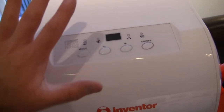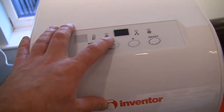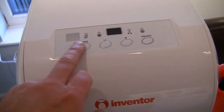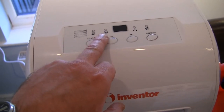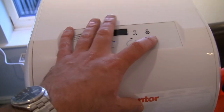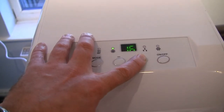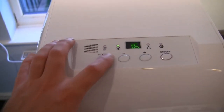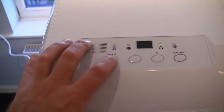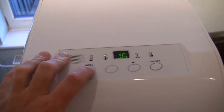After playing around with the settings on this unit, I can tell you I found the best mode. There's actually cool mode, dry mode, and fan mode. The best way to operate this is to turn the unit on and press the mode button until the first green button lights up — that's cool mode. Then press the minus key until you get down to 16. That's how you get this unit the coldest. The mode button cycles through the three options: press it once for cool, again for dry, and again for fan. If you want air conditioning, you want it on cool mode.